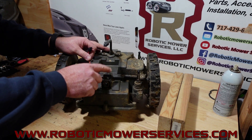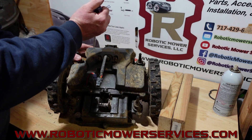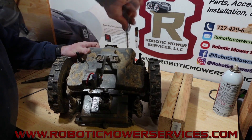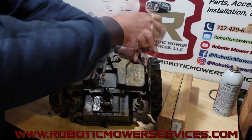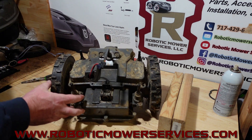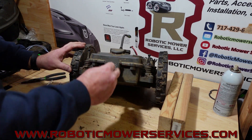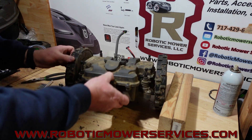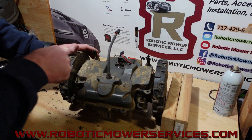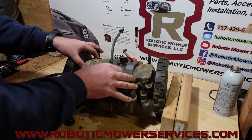Now we've got that out of the way, we can take our screws out and remove this chassis cover. You're going to use a T20 Torx bit screwdriver. Now you're going to have some wires connected in there, so don't go lifting straight up on this and yanking it out. You also have a warranty seal back here at the rear bumper, so make sure you got everything cleaned up as good as you can before you take it apart. Just get this dirt out of there and we're going to pick up on this easy.